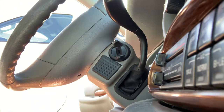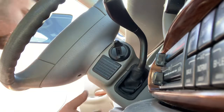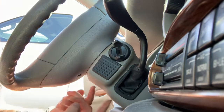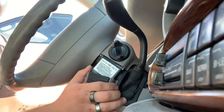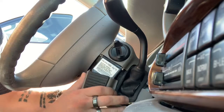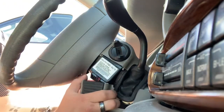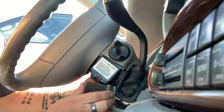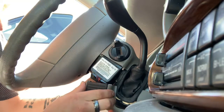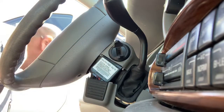No point in having that leashy anyway. So we're just going to pick over our ignition — single-sided lock — pull it out and read our code. We've got two torx bolts underneath here, I've already pulled those. Let's see if this will come out nice and easy and drop the bottom shroud. This one can be a beast to get off and on, but I'll try to leave it there and see if that'll give me enough room.